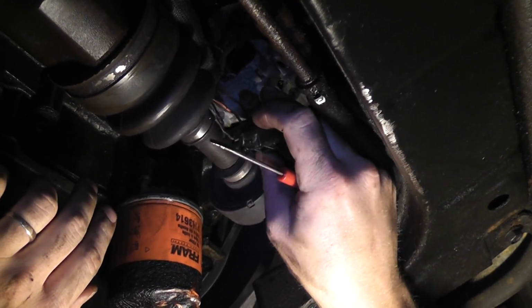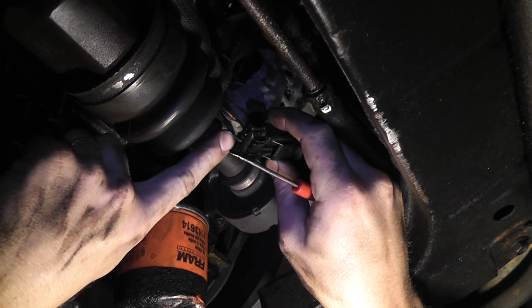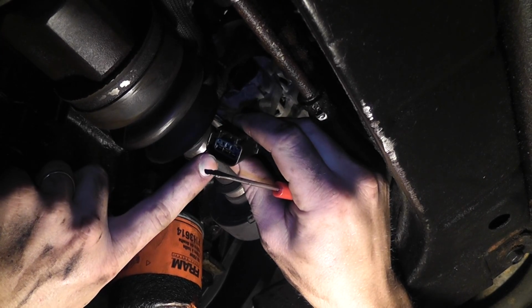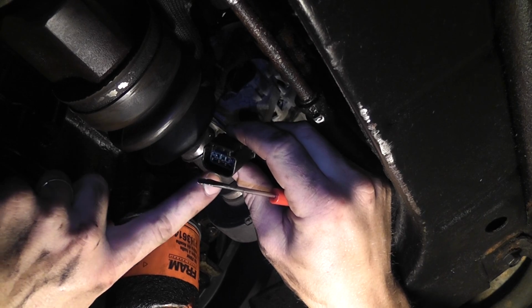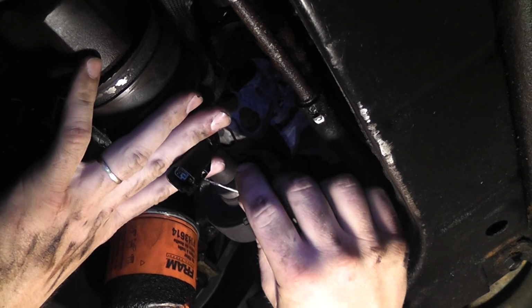Okay, while I'm here, I'm gonna show you guys how to fix a connector like this. And I wanna work with these 2 broken wires on the workbench. This gray wire I wanna pop out of this connector. To do that, you have to get this blue locking tab off on the inside so we can get to the release points of the terminals. And so the first thing is to do that, and I'm gonna try to keep my hand out of the way so you can see what I'm doing.